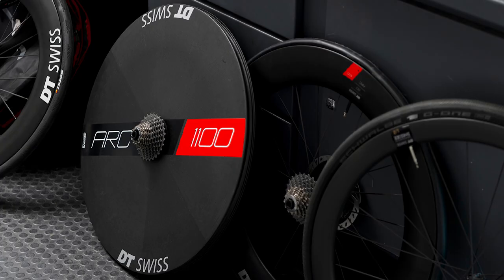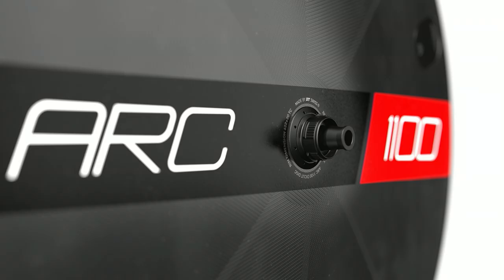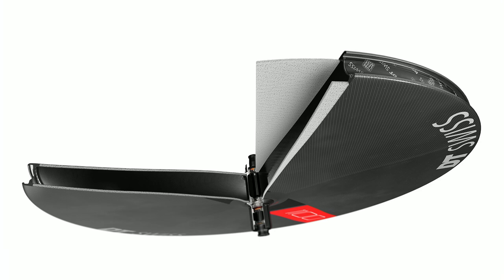So we set some cornerstones. We wanted to have a 20 millimeter inner width in order to make use of wider tires. We also wanted to focus on a lightweight construction and have a disc brake ready wheel set with a disc brake through-axle hub. Especially the carbon construction of our disc wheel was a really big point in order to make it lightweight. Because of this, we used a sandwich construction on both sides, incorporating an ultra-light foam which helps to transmit drive and braking forces effectively.